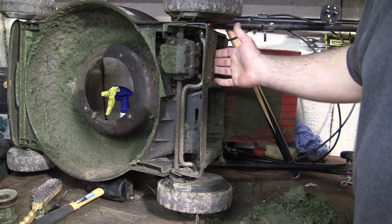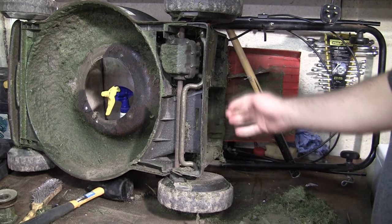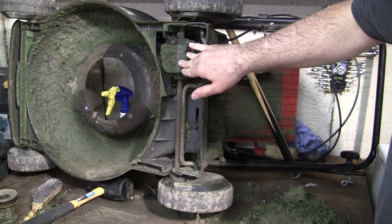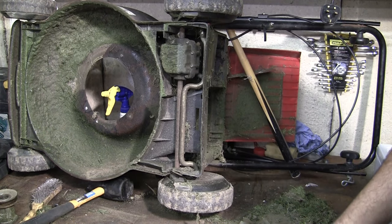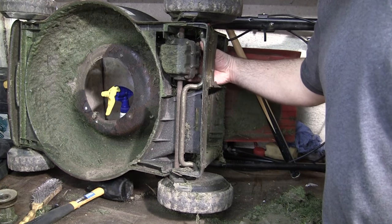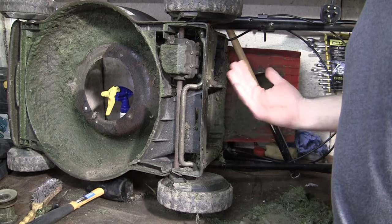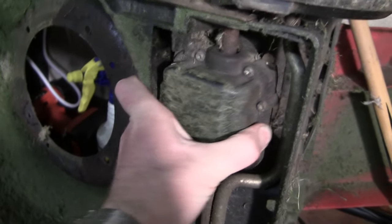There's a spring tensioner on the back but they're all slightly different — some connect up here, some on the back, and you can adjust them if they're not working. The problem with a lot of these is they have plastic components inside, with a metal gear sometimes running against a plastic worm gear. The plastic worm gear unfortunately doesn't last very long after a lot of years. I'm going to show you a few simple things you can check yourself to determine whether your transmission box is packed in or whether something else is broken.